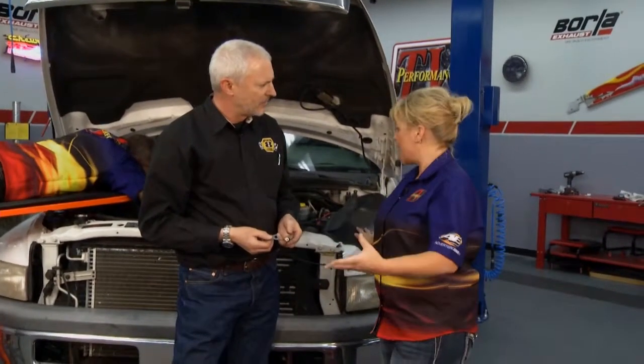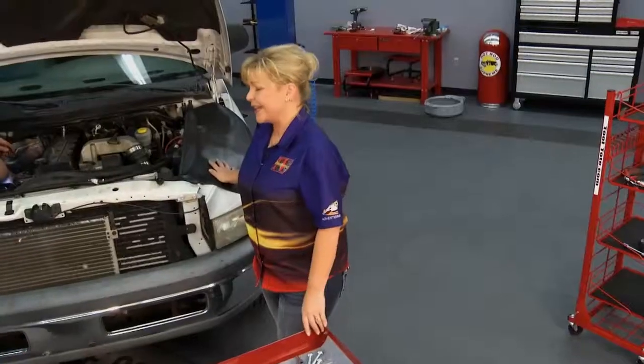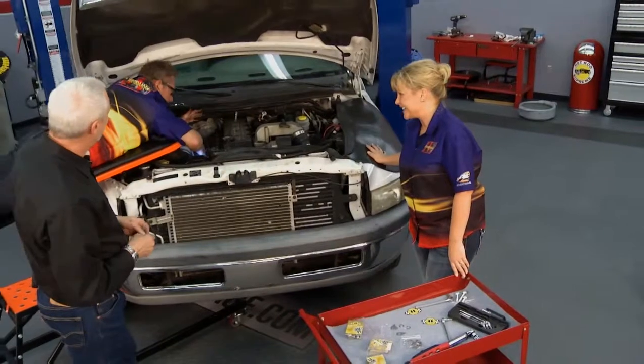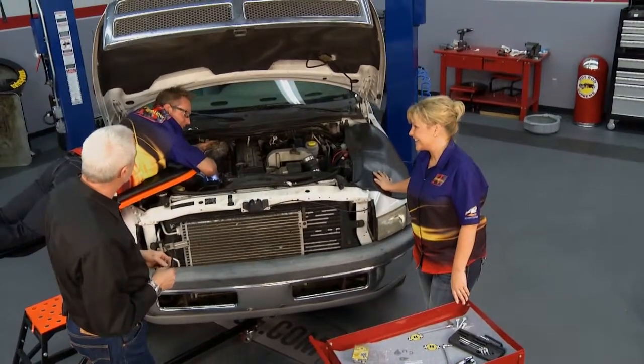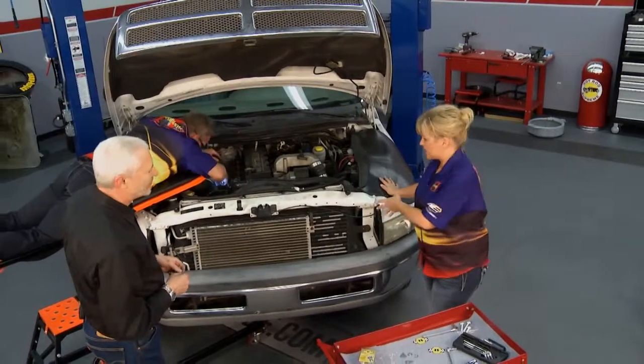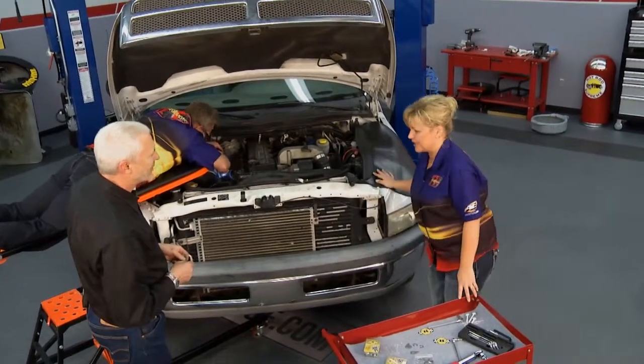Because we're dealing with a lot of heat back here, we've got to have stainless steel. Tommy noticed that those grade 8 bolts weren't staying fastened. They were not tight, and this isn't the easiest thing to get into, so I want to tighten them up once — I don't want to go back and have to do it again. We're going to get you set up with the kit and let you tighten it down for one last time.